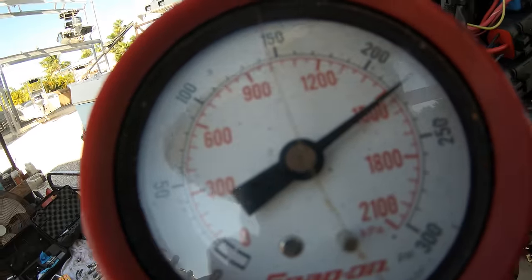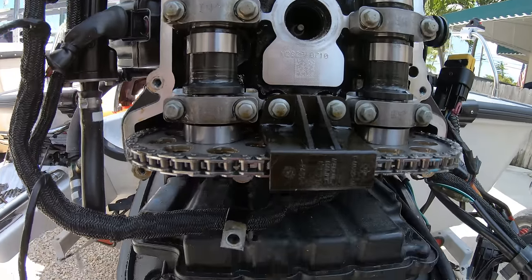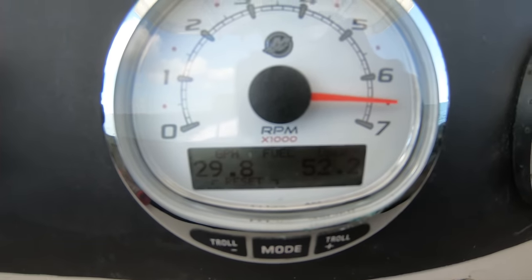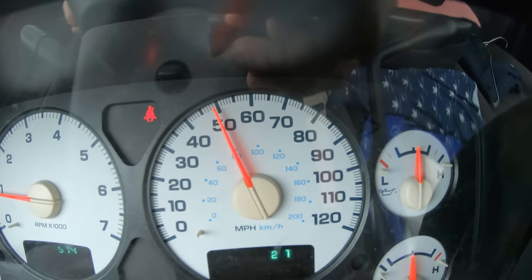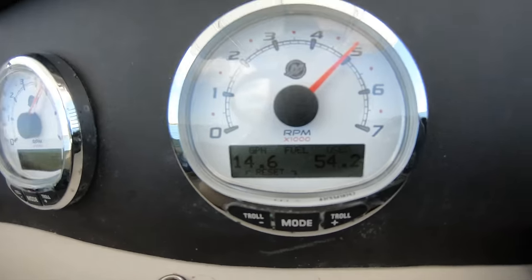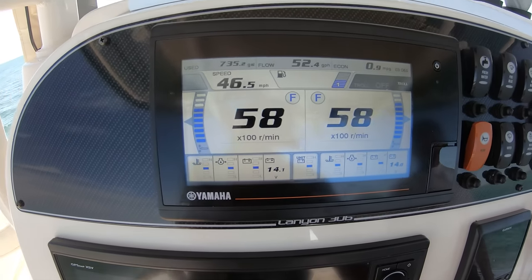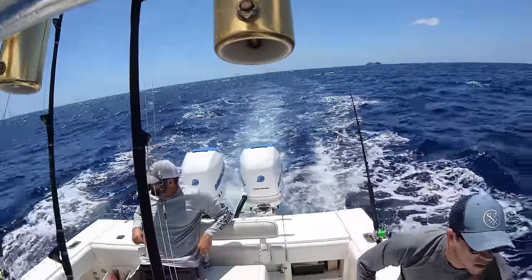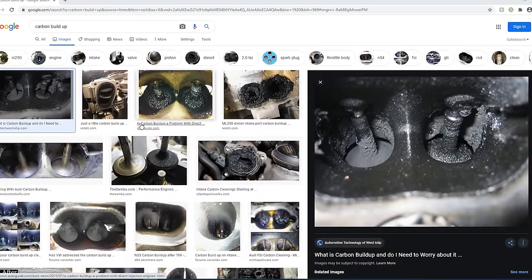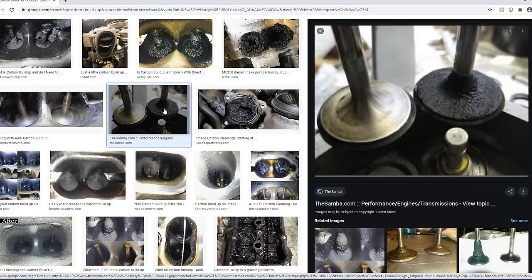With a four-stroke, you are looking at having valve issues as well as the piston rings and the cylinder head, like you do on a two-stroke. This is where carbon build-up comes into play. A lot of people don't realize it, but a boat engine is designed to be operated at much higher RPMs than a car. You could be doing 50 down the highway and only turning about 1000 RPMs in your car, whereas in your boat you will be cruising around 4500 to 5000 RPMs and then up towards 6000 RPMs at wide open throttle. If you spend a lot of time idling or trolling where the engine is spending hours at 1200 to 2000 RPMs, carbon can get built up inside the cylinder and on the valves — the engine isn't getting hot enough to burn off this carbon, and over time it can build up on valve seats, valve stems, and on the piston.